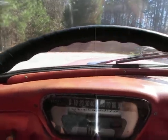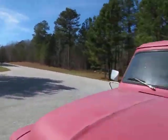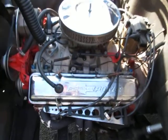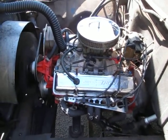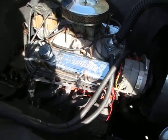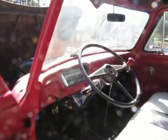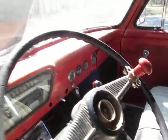Reverse works. Engine runs fantastic. The engine runs perfect — sounds like it might have a minor exhaust leak, I think at the donut on the passenger side. You can just hear it runs great. I believe the donut down below is what needs to be replaced. The engine doesn't overheat, it doesn't smoke, and I've driven this truck a couple of times. Every time I drive it, you just barely touch the key and it fires right up. It's a really good, solid running engine.